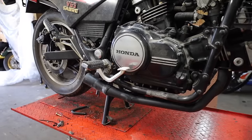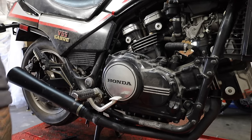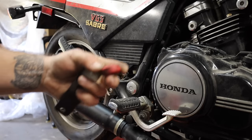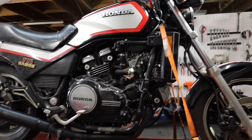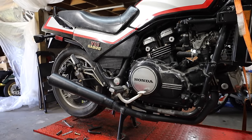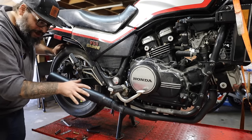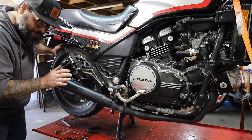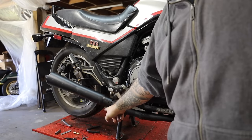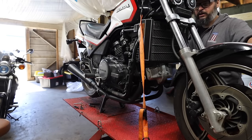I ain't bitching too hard, I'm lucky to have a lift. This doesn't seem to attach to anything here, so I'm going to have to make a mount — not a big deal. Even though this is a rigid mounted motor, just to make myself feel better, I'm going to use a polyurethane spacer. I know there's going to be a fair few people who would have said leave that damn exhaust pipe off there — David from Forgotten Angels being one of them — but let's see what this thing sounds like with a silencer on. You guys will not be able to tell how ear-piercingly loud an open exhaust on this 1100cc V4 was through the computer screen. It would have been unbearable on the road. Don't have a clamp that's going to work for right here, so substantial exhaust leak, but we'll get something eventually. It starts, it idles, it braps, it sounds good.